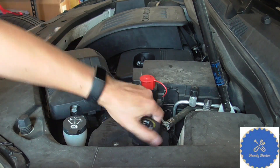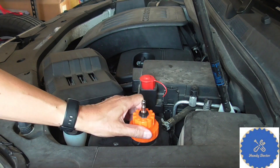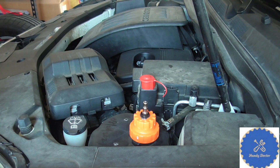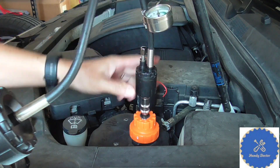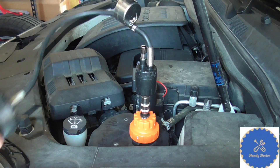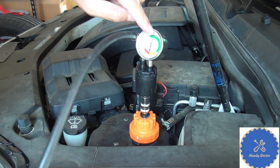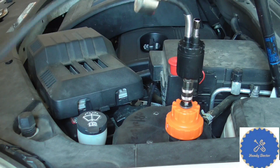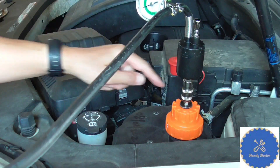My car is totally cold. I remove the cap and put my number five adapter onto it. It's snug. Then I take the air pump with the pressure gauge from the kit and slide it onto the adapter — it's a quick-connect adapter — and start pumping air. You want to pump until 15 psi typically, or whatever is labeled on the cap. It is 15 psi for my car. I see the pressure coming up. I go to something like 13 psi and it starts leaking from somewhere.